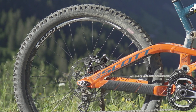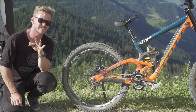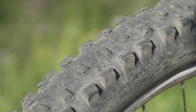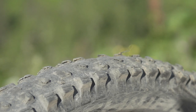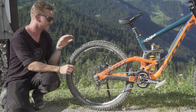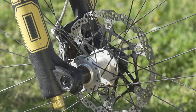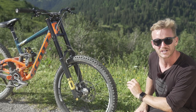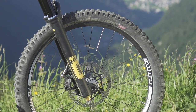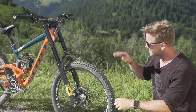Let's talk about the rubber on this bike. This is a Schwalbe Magic Mary, a 2.35 tire. It's a well-used tire — in the middle there's not much magic going on. But there is nice tread on the side of the tire, which is key because you've still got grip in the corners, while you've got a high-rolling tire in the middle on the straights. Up front, same wheel build but laced to a silver hub. There's a lot more magic up front — this Schwalbe Magic Mary has a lot more grip, and you do need that grip up front because this is where you're driving the bike in the direction you want.